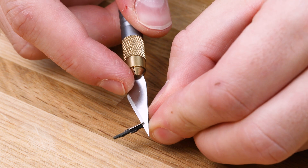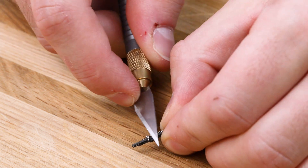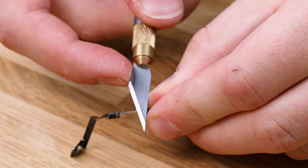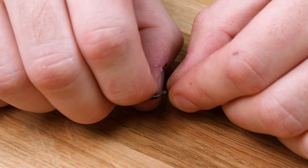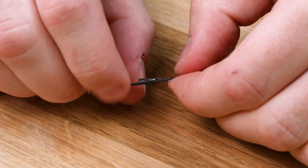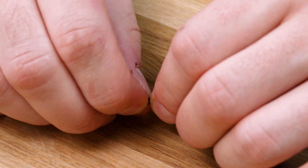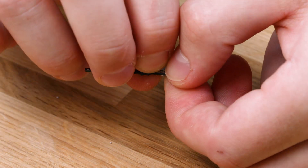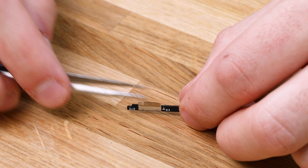After cutting the plates there may be some overhang. You'll need to cut this with a blade or something similar to even both the plates out. Now you can lift the plates with a spudger — be gentle when doing this as they can break if you use too much force. If your plates are slightly bent, then use tweezers to flatten them.